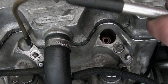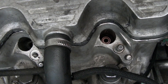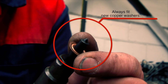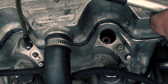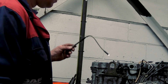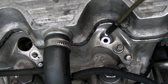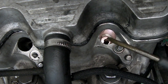The damage is caused if heavy pressure is applied, because the seat where the copper washer sits needs to be flat and clean. So remember: if you're taking the injectors out as a set, always replace the copper washers. You can see by the tool I'm using here — it's an inspection tool, better than a torch because you can reach down into recesses and actually see. Make sure all carbon is removed before you fit new copper washers and refit your injectors.